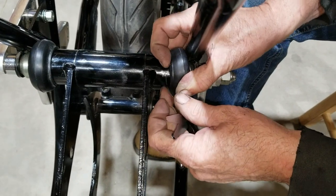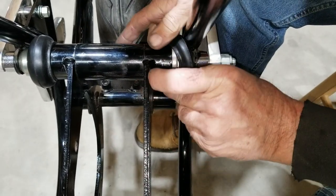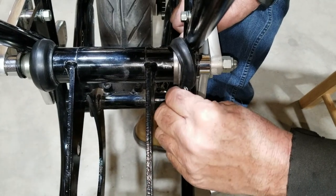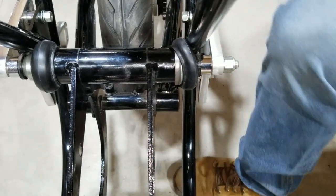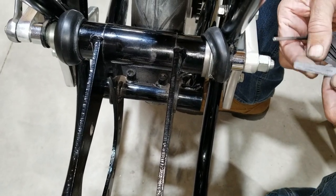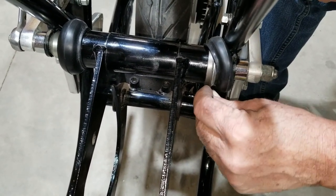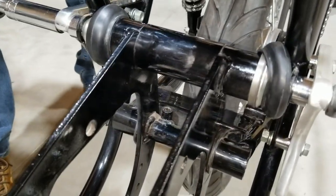See, we got a six go in there. Yep, six fits, barely. Okay, so I gotta go a little more. Trying to get the back into it right at 6 thousandths, and I can just get it in there. Let's try an eight. I can't get it really in there, so it's between. Yeah, it's looking good. So yeah, with 6 to 10, you really have it tight.